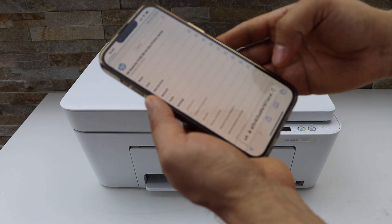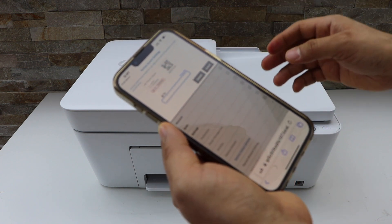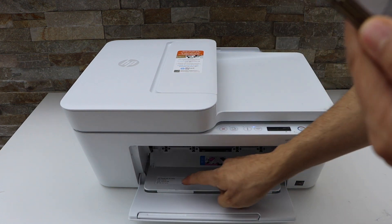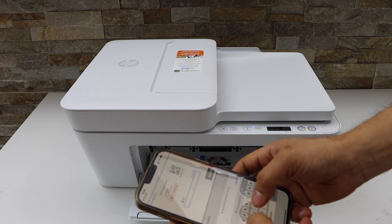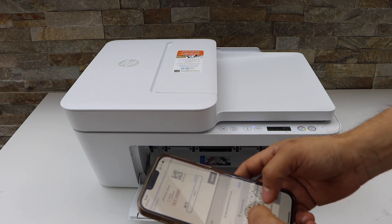Select Restore Defaults, then Restore Factory Defaults. Now enter your printer PIN — it should be inside the ink chamber. If you open the ink chamber, the PIN is written there, always next to the lock sign. The PIN should be different for each printer, so write it down.